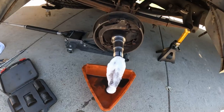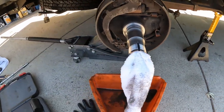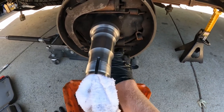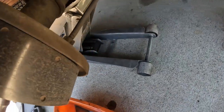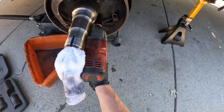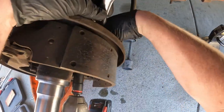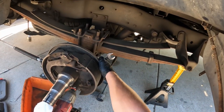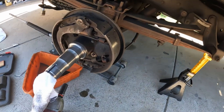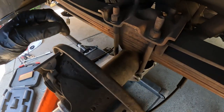What I like to do is take pictures with your cell phone at each step — that way you know where everything goes on the new one. First, we're going to remove the emergency brake cable. It's a three-quarter-inch bolt and nut here. Go around the back and hold that side with a three-quarter-inch wrench, holding the bolt on the back side. Now the cable will come off.